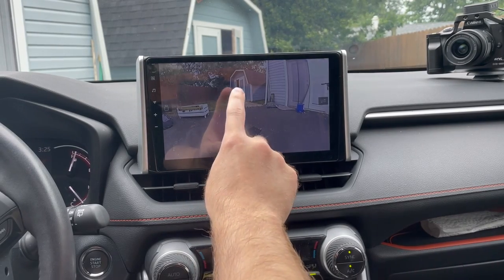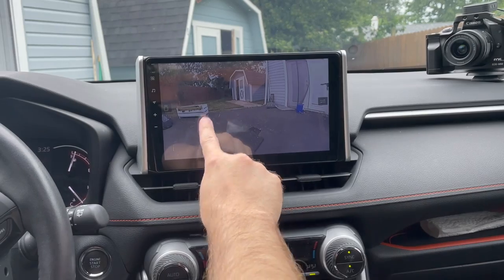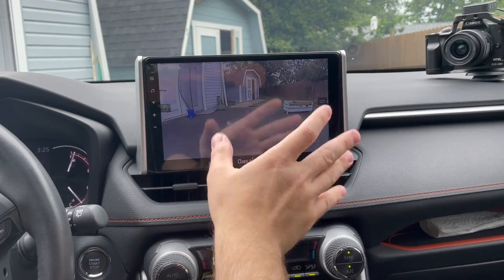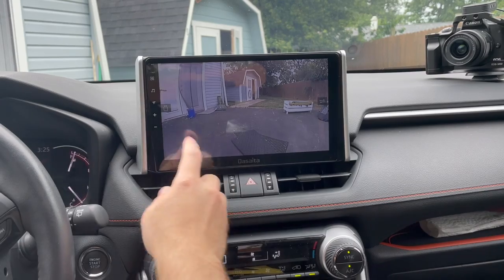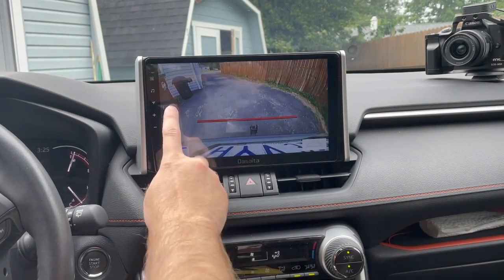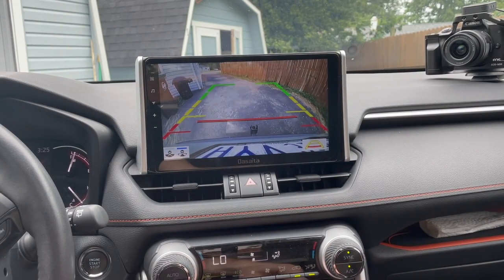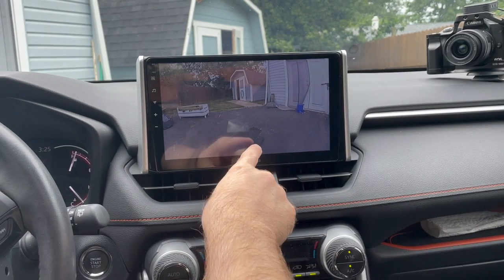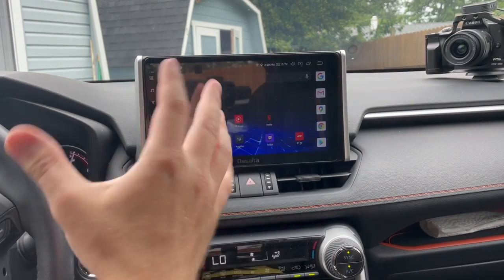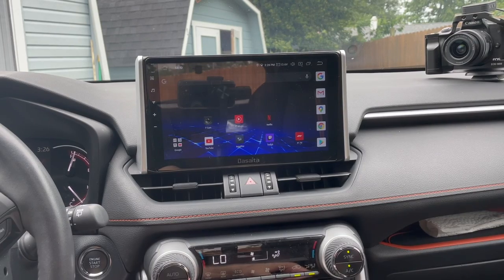However, I've noticed that it is frequently inverted. You can see my shed is on the right side, but in the real world it's on the left side. You can undo this by pressing the icon over here to re-invert it. This is not always permanent, so you should assume it's always going to be inverted, unfortunately. If you click on this other icon, you can see your reverse camera while the car is in park, reverse, or drive. If I put the car into reverse it will show the reverse camera, and if I put it into drive you will see the front-facing camera again — inverted, but it gives you a quick three to five second view of your front bumper area when you go from reverse to drive. You can change that timer in the CAN bus settings.